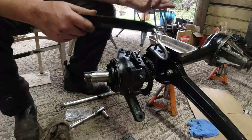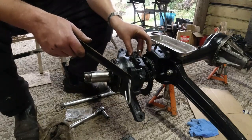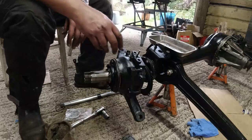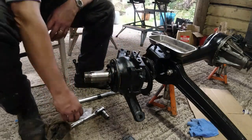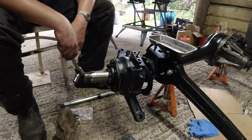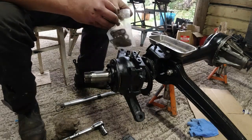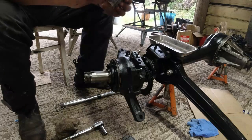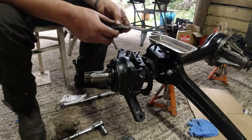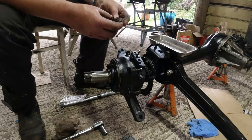You can get really fine spring balances. I generally get a feel for these things. You'll need a torque wrench because obviously you need to do the swivel pin bolts up to 60 foot pounds every single time you add or remove a shim. Test it again because there's no point testing it while it's loose. I'd also suggest you just have a second wrench so you can undo the thing, because you keep taking these things apart and putting them together. I've got a great bag of old shims that I've used over the years — I clean them all up and use them again. They come in so many different thicknesses, from the mega thick ones down to the thin skinny ones, because it is a bit of an exact science.